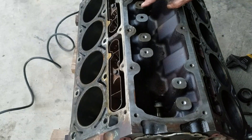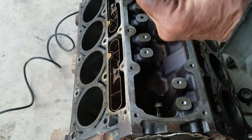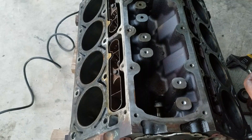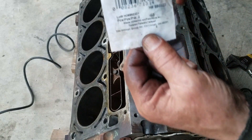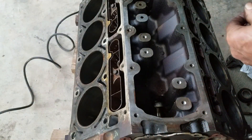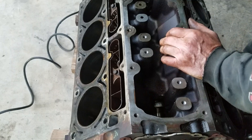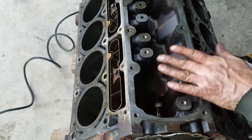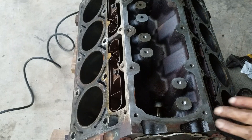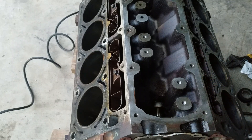It's got o-rings but after time the o-rings can start leaking and you lose pressure there. I got two plugs for like a dollar thirty cents at Lowe's — it was four dollars and some change for all eight plugs. So it's cheap enough. You can put a plain cover on it, a DOD delete cover, or whatever, but if you plug these you can cover the top with anything. Alright, thanks.